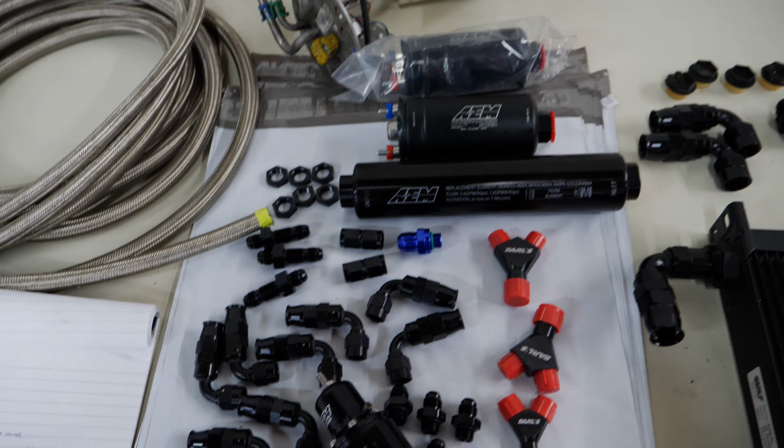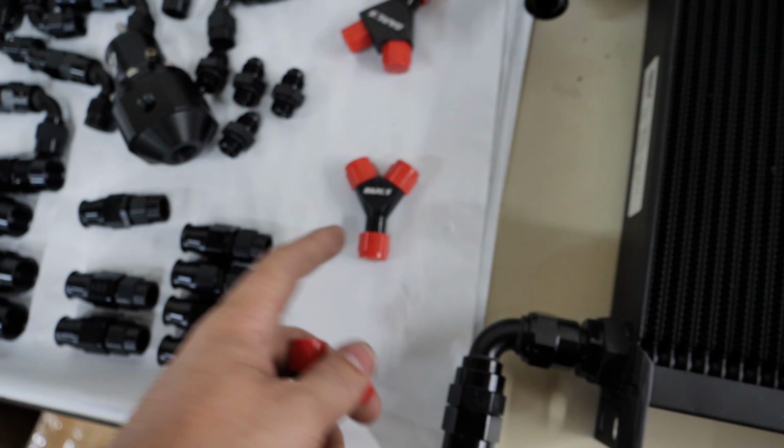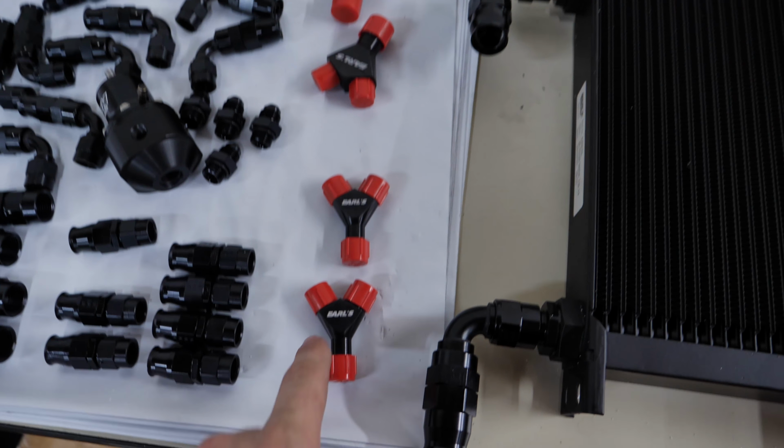These are 6AN lines. And realistically, I'm using one of them on a feed line and one of them on a return. Literally, the fuel pressure that comes out of this goes over to the other tank and spins a little wheel, kind of like a turbocharger, and that wheel spins another wheel like a turbocharger that dumps fuel from one saddlebag to the other. That is not an electrical pump, it's a pressure-based pump. And so it siphons off of the fuel pressure. So I'd have to have one connecting into that little merry-go-round, and then one coming back and dumping back into here.